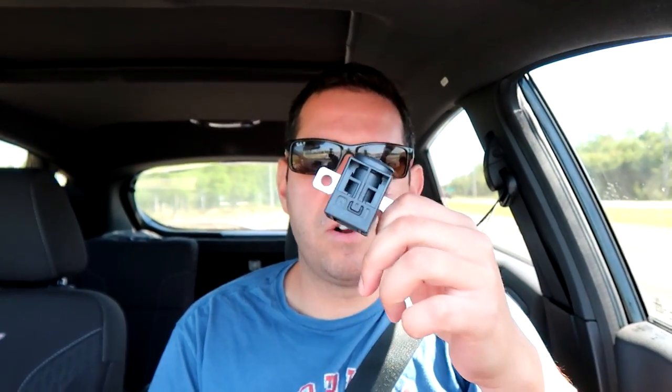The other reason I was there is I had to pick this piece up here. You guys might be familiar with it, but this is actually a part on modern cars now, and it connects to where your battery is. And basically there's an explosive in here, like an airbag. The explosive in here blows, which this one did, it will prohibit your car from starting.